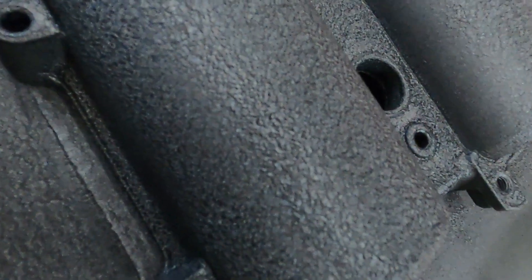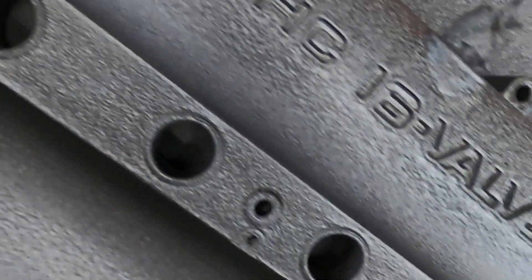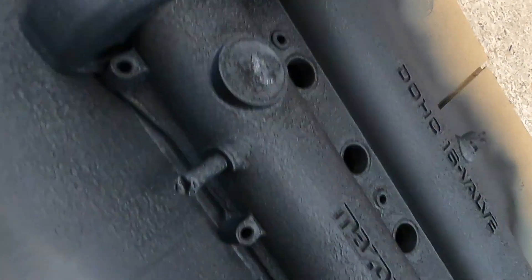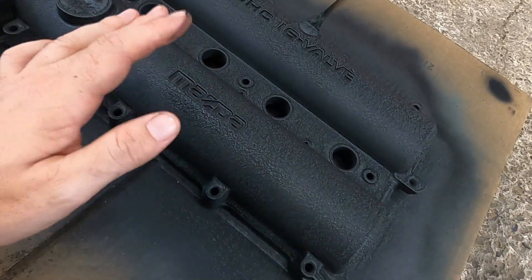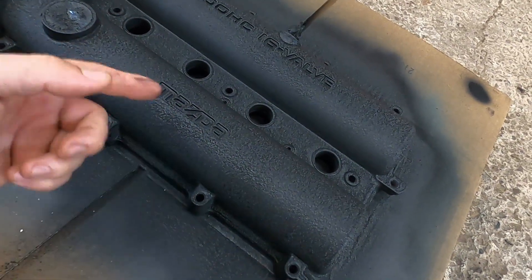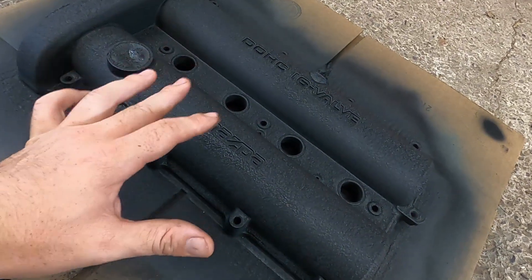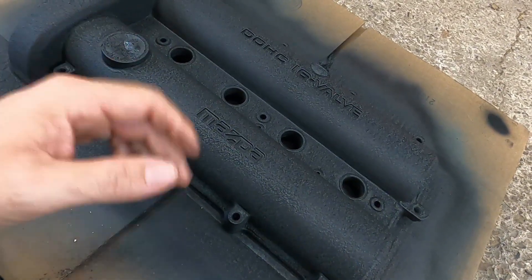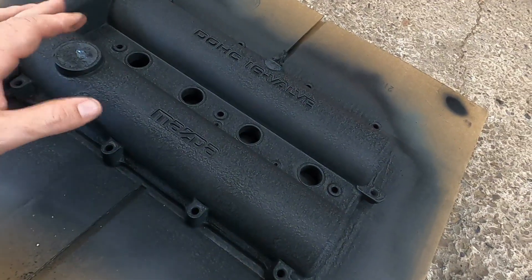This is one of the best results I think I've ever gotten. Here's some close-up shots — you can see the wrinkled finish. It is extremely hot at this point, so I'm not going to try to take the tape off this little bung. Overall, the finish is really good — I'm actually pretty proud of this one. You can see on Dylan's car we've filled in the lettering, but Joe doesn't want that done, and it's a pain with wrinkle because the paint will climb out of the lettering and you'll have this splotchy paint around there. I would suggest letting it dry for up to 24 hours before you install it — I've had cases where the bolts will flick off the paint right around the bolt holes if you don't wait.